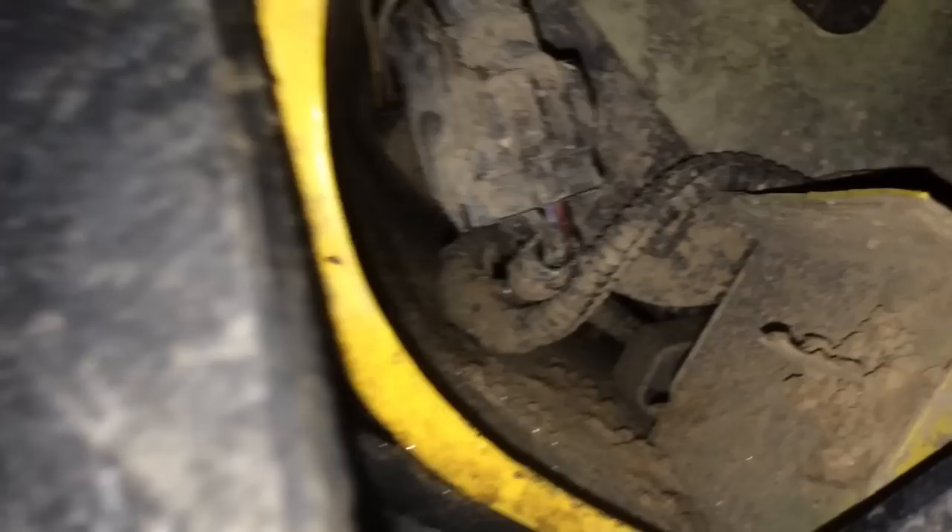I found the blinker on the passenger side — it's a red and black wire. So I'm going to go back to the driver side, find that red and black wire in the main harness, test it, and then tie into it. I went ahead and tied all the wires in.